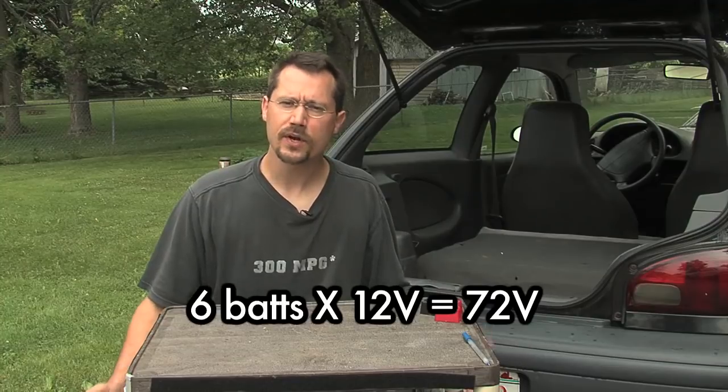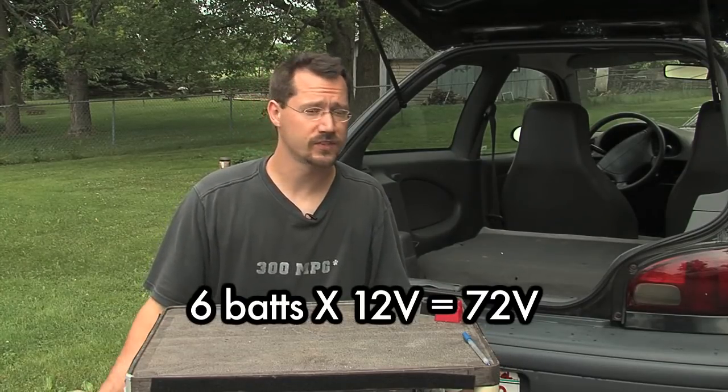What batteries do you want to use in your electric car? Ideally nickel or lithium-ion, but those are very expensive — the only person I know with lithium-ion in his car paid about the cost of a new car. My project is a low-budget fun vehicle, so I bought used 12-volt gelled lead-acid batteries. The current configuration is six of them in series for 72 volts. It goes about 45 miles per hour and gets around 20 miles of range; with new batteries I'd expect about 30 miles.